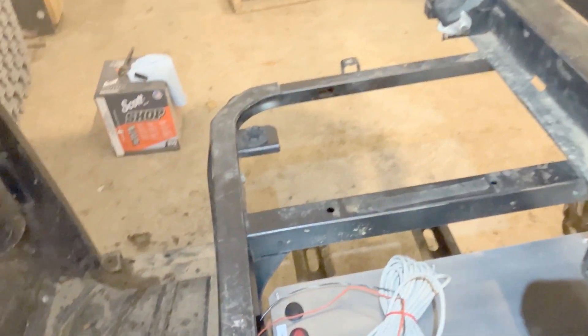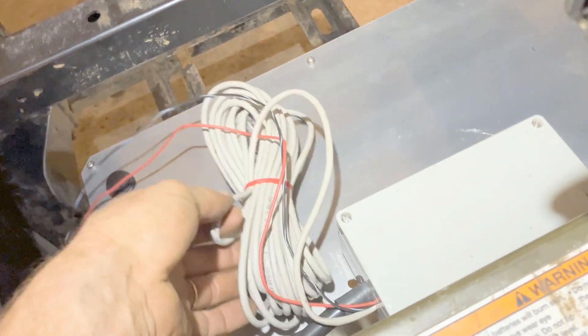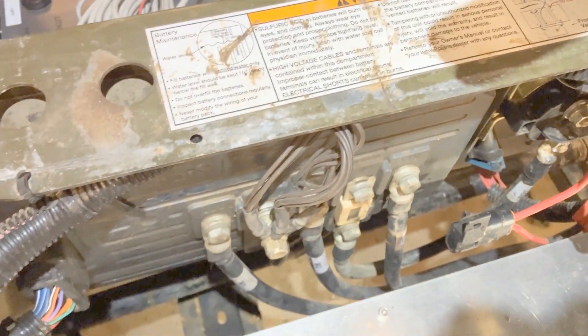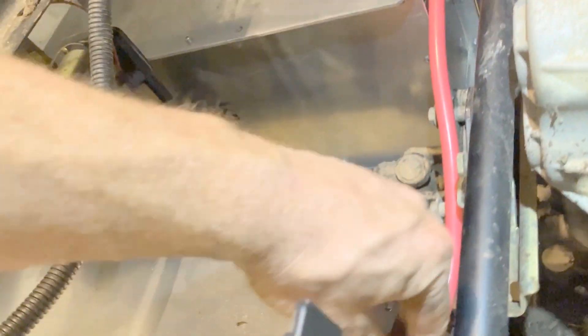Battery one is connected, save for the shunt. I'm going to hook that up in a minute. The negative terminals are all wired up and wired to the controller. The positive side is wired into the top of the contactor — nice and snug. And these guys are wired in here and here — nice and snug too.